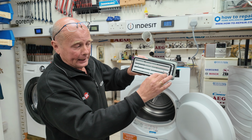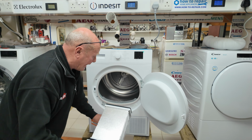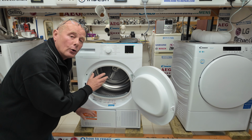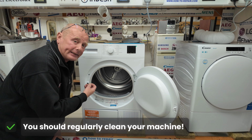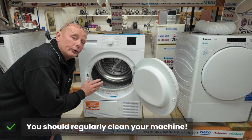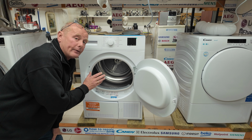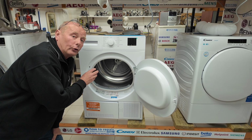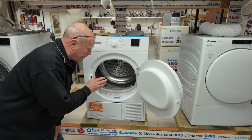And then you have plates at the back here, which also need to be cleaned. This air then travels all the way to the back of the heating unit, where it's drawn back into the machine after the moisture in the air has been collected. If the system blocks up with fluff, all you are doing is sending the warm moist air back up to the heater, and that's actually not very good for the heater, because electricity and warm moist air will cause earth problems over the long term, and it's not actually good for the heating system.